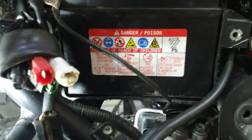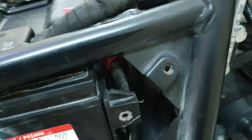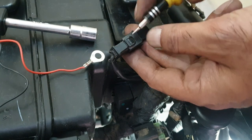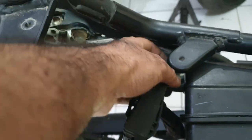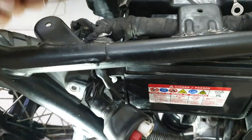The only tough one was the ABS wire. Now let's make space and get all of this wiring out of the way. Press this thing down and it will come out from this side — same for the other side. The positive one is out; for the negative there's another connector here — same mechanism, press and pull. Beside this is your fuse box; get it out of the bracket on the airbox. Now your wiring is free.